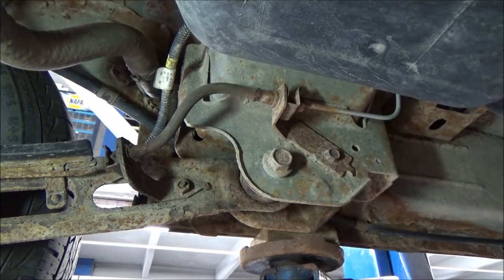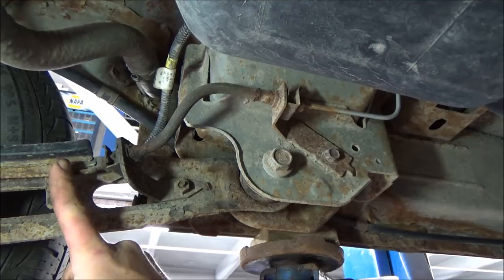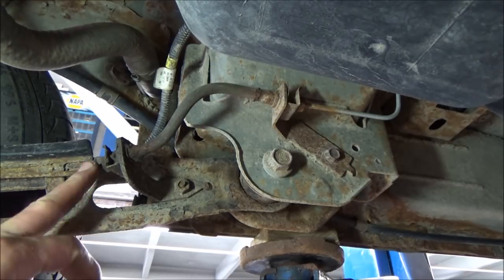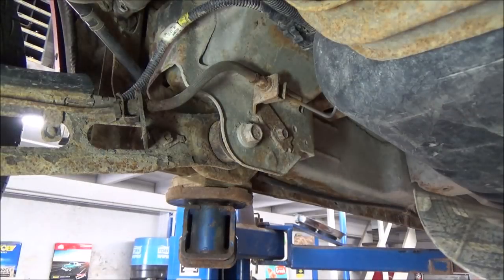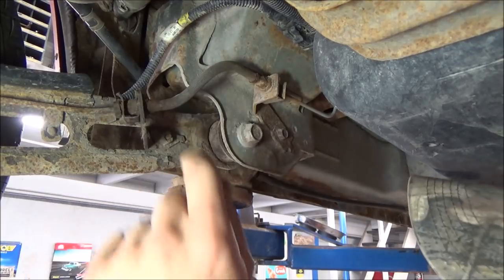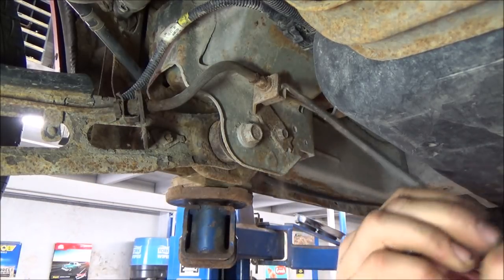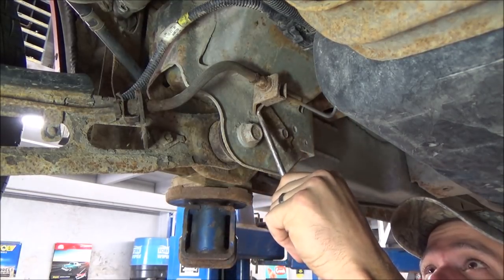So what we'll do is put the hose on, get this unhooked, and make this line from here to the wheel cylinder. I'll show you that process in case you've never seen it — we'll flare it. Let me look here: it's a double flare on this side, probably a double flare going into the wheel cylinder too. So I'll show you how that's done. First things first, we've got to try to get these locks off there. I'm just going to go at it with a pick and see if we can get under there and start moving them around a little.